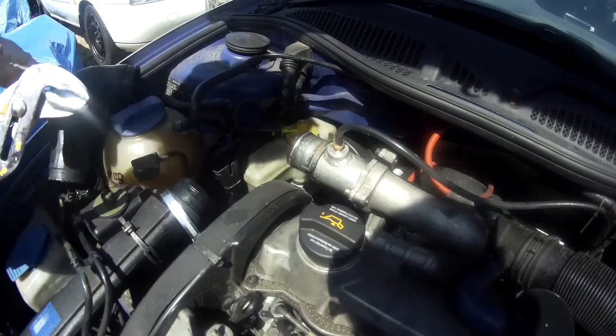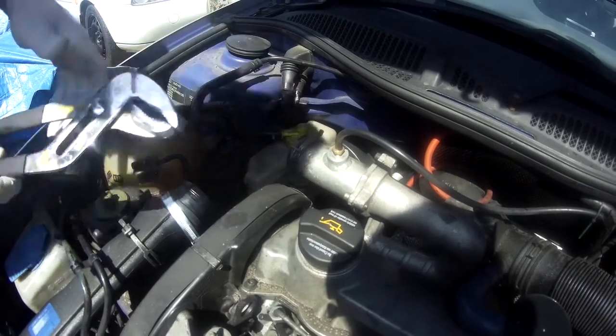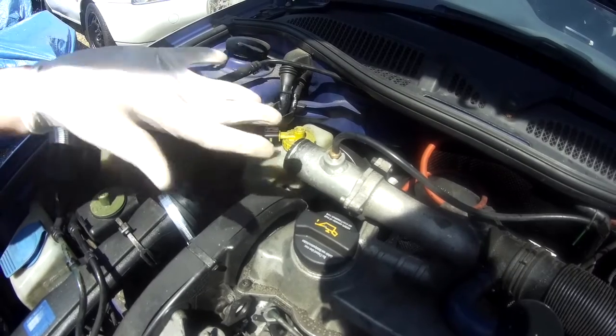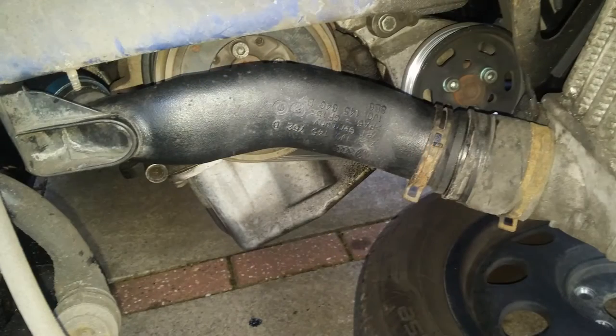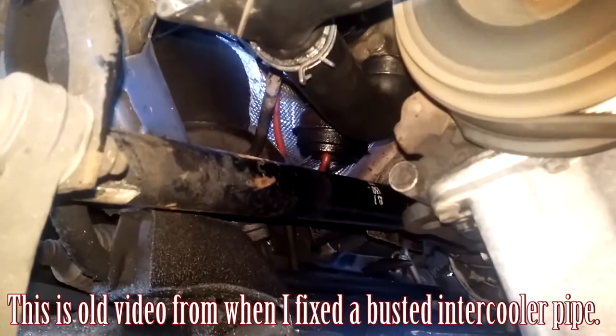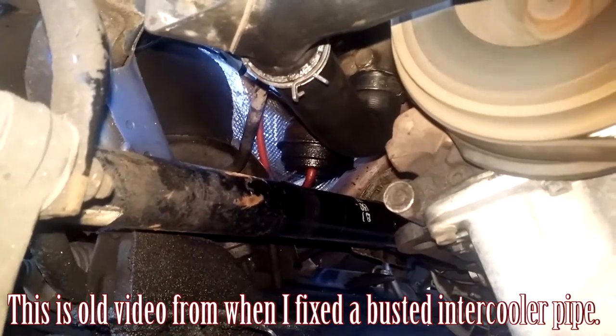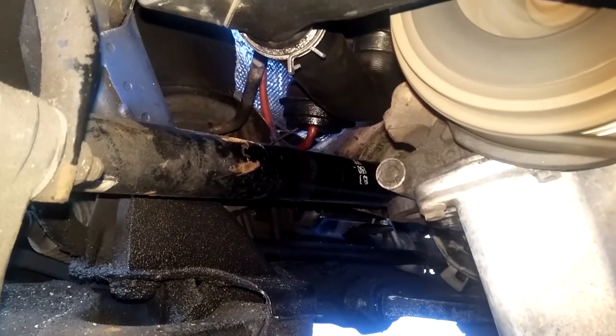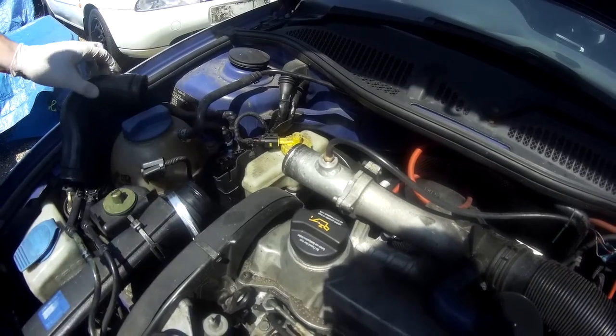That's probably more to do with the first air pipe that runs from the air box to the turbo. You can see from my on-screen examples that they just fly off, but the other issue you face is depending on the amount of space you've got to work in, you can't get the tools in — like the wide grip pliers or pipe wrenches — to be able to maneuver things very easily, and I've really found this problem when my piping went that was underneath the turbo.